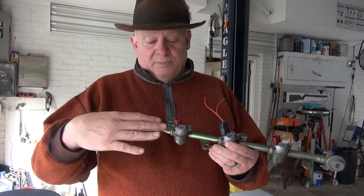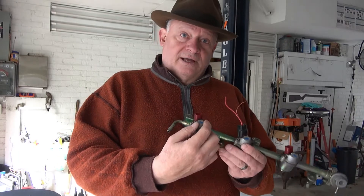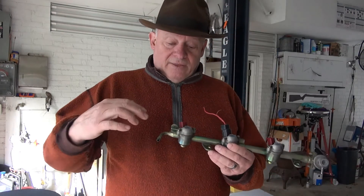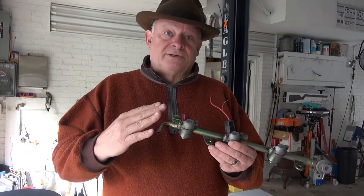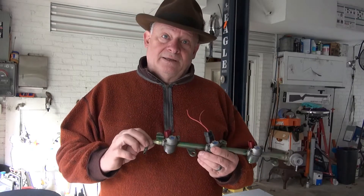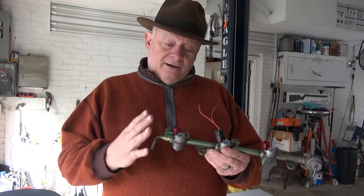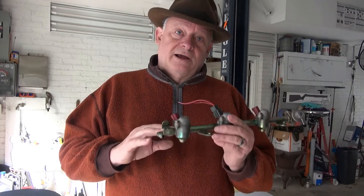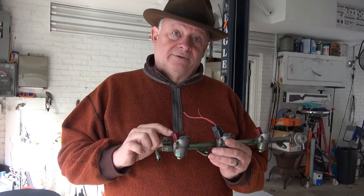You can put two small flat blades on each side. There are little features built into the fuel injector that allow you to put a flat blade in there and pry it out, applying even pressure on both sides. It works just like a gear puller — it popped right out. It was in there tight because it had been in there for 20-some years, but it pops out perfectly. You don't have to remove the entire rail or press it from the backside — you can just remove the one injector that's giving you a problem.